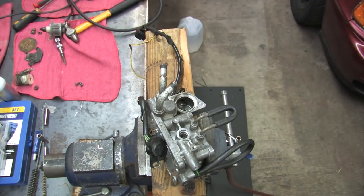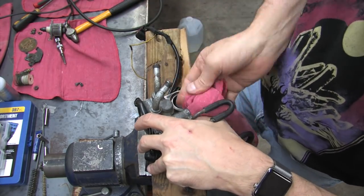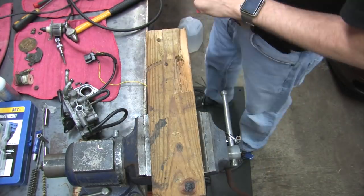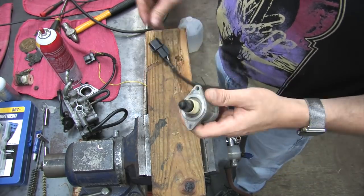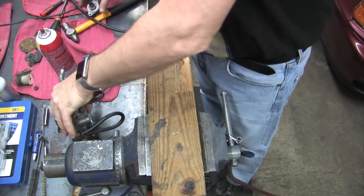You might notice I didn't touch the O-ring seal boss with these tools. That's because they're machined surfaces. Only use rags and solvents to clean up the O-ring seal bosses. The ISC gets caked with funk too. Rather than drowning an electrical part with plastic bits inside it with carb cleaner, I'll just douse a rag with carb cleaner and wipe off the carbon that I can get to externally.